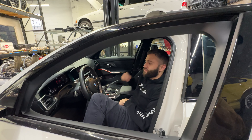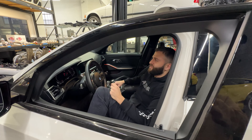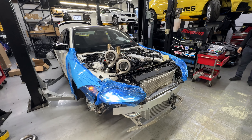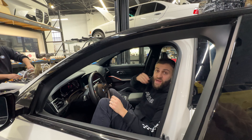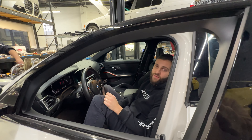A lot of people crank cars to start them and then crank for a long time before starting. I've heard people say just turn the car right on — never do a long crank — because the oil pump flows more at 1,500 RPM than it does at 200 RPM cranking. You're cranking for two minutes trying to build oil pressure at 200 RPMs versus five seconds at 1,500 RPMs.